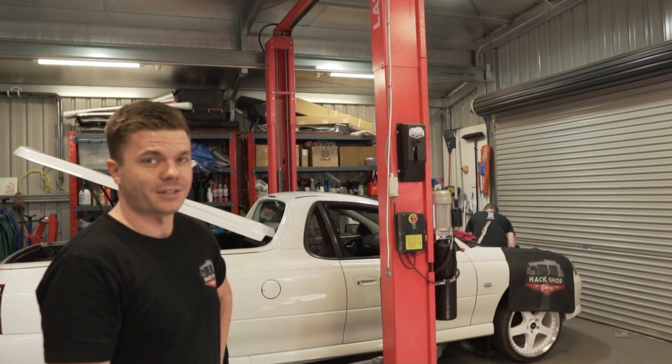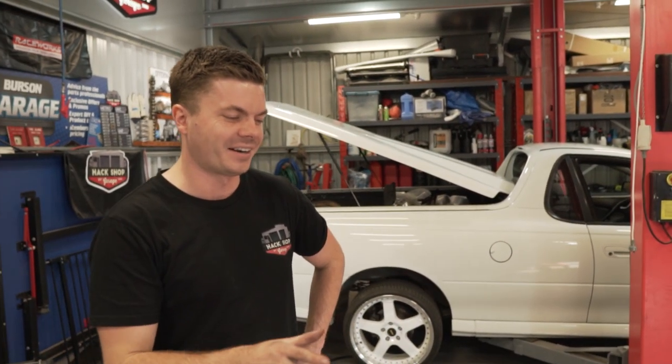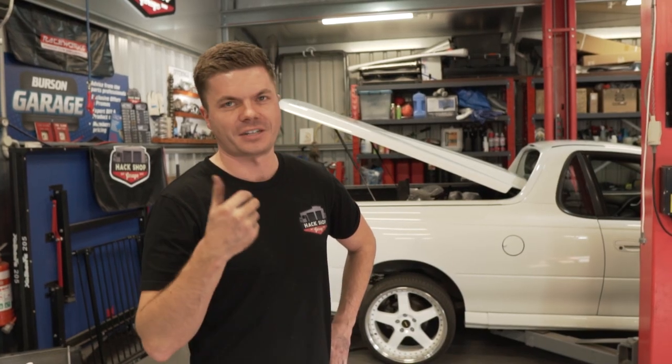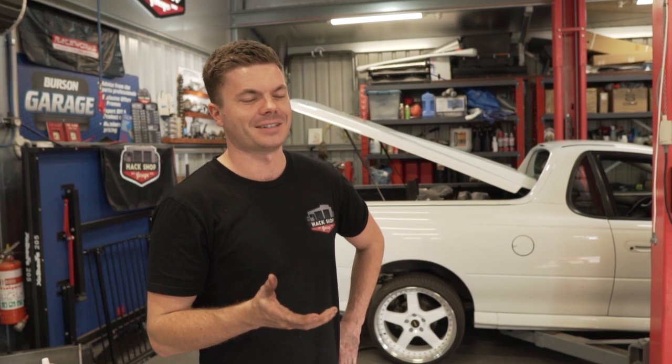All right, so we just can't do it. We can't go on and leave that timing chain as it is. Even we are not that dodgy. It could be fine, it might not, but then we just looked up what a timing chain's worth, a double row timing chain set with sprockets. They're only worth like $200. So for the peace of mind and knowing that we have a new timing chain and a double row timing chain on it, we're actually gonna stop here working on the engine.